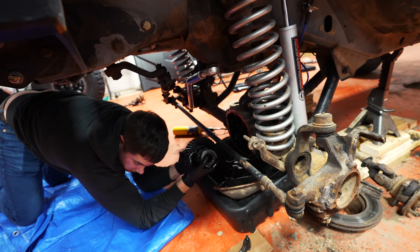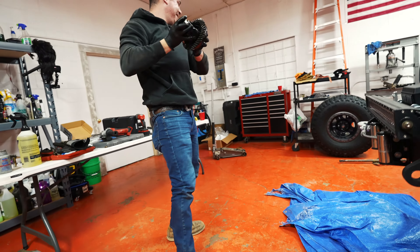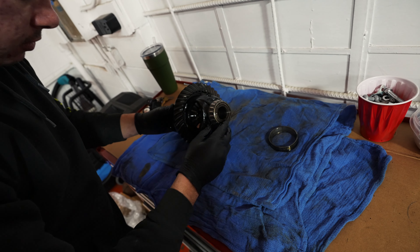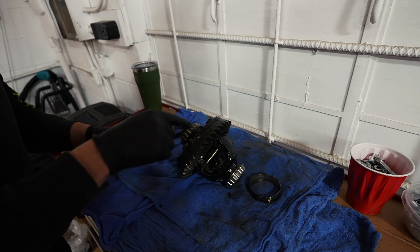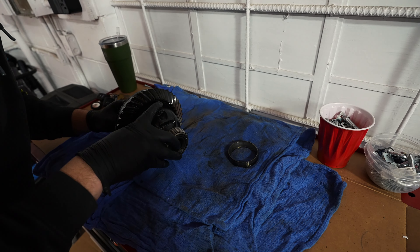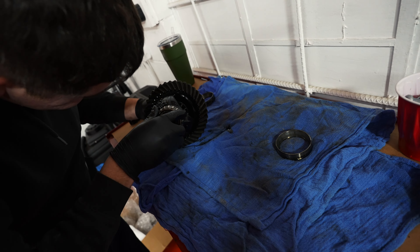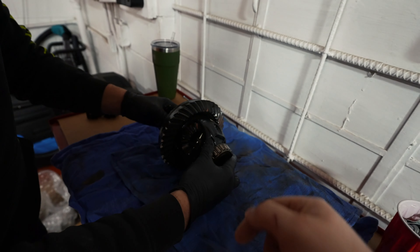Got a spot picked for this thing — right on that red toolbox over there. All right, so these are the five components. Make sure those don't come out — isn't it cute, little guy. Now we'll have to unbolt all that, pull the ring gear off so we can get the pin out. We've got two pins: take the big pin, and there's also a roll pin right there. Punch that out, take the ring gear off, then punch the center pin out.